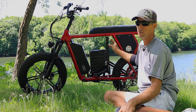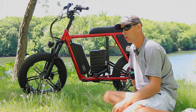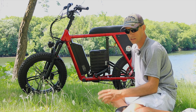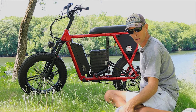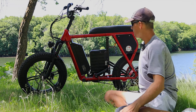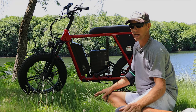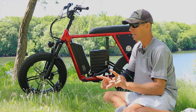Back to the controller — this thing didn't really gain much top speed on a full charge on total flat ground. I will hit 30 miles an hour, but it just doesn't seem to want to go any faster. I tried a different controller and that one still only got 30 miles an hour. I feel like this motor is just limited to 30 miles an hour — all revved out. For people who have a surging issue, as soon as I replaced this controller, the surging issue went away.